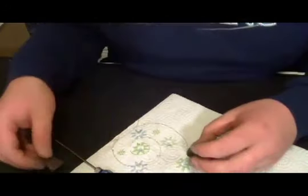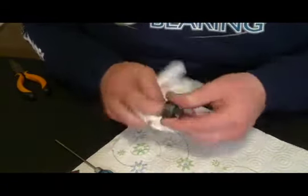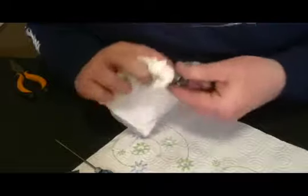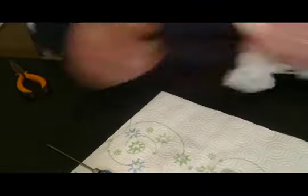Sometimes it takes a couple minutes. If it's really bad, you can use a sanding drum on a Dremel tool and just lightly go across the inside until you get it nice and smooth. You can see all the stuff that's come out of there. Grab a clean paper towel and go through and wipe everything out of the inside — try and get all that sandpaper dust and clutch dust out of there. Our clutch bell is cleaned up and ready to go.